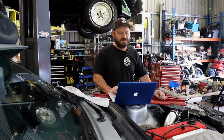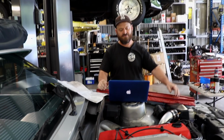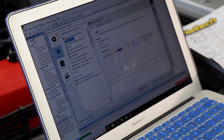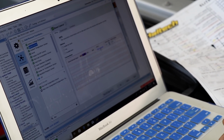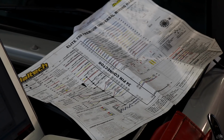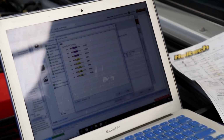Now down to functions. Every sensor on the engine needs to be configured. We'll just start at the top, boost control. Yes, it certainly does have boost control. So we've got to check that our output connection's correct. I have boost control on DPO2, so we do have to edit the connection. Change it to DPO2.